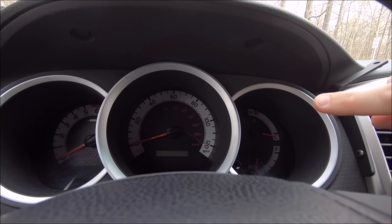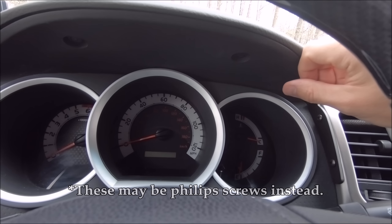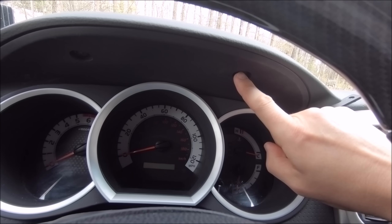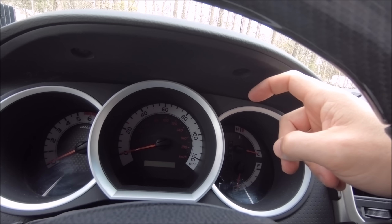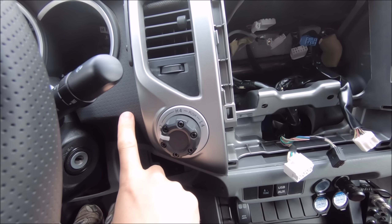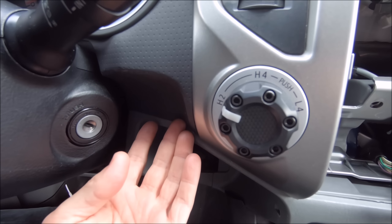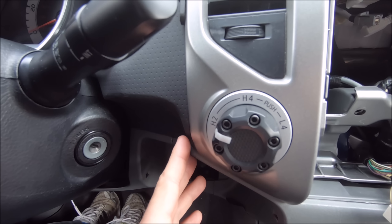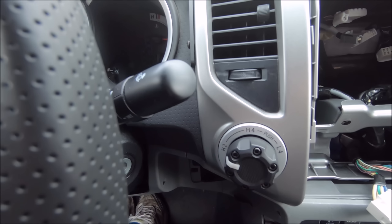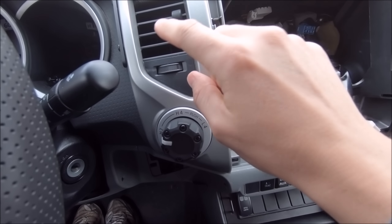Next step — a little hard to see — there are two plastic tabs at the top of your steering center gauge cluster. Just take a small pointer or screwdriver, depress the center of the tab, and take your plastic trim removal tool to hook both of these out. The next part is pretty tricky. We need to loosen this black plastic right here using your trim removal tools. Start down in the corner, get your fingertips in there, and pull it away — go up maybe five or six inches, about half the length of the black plastic — to expose the side of the tabs behind the silver plastic so you can pull the entire thing out.